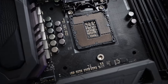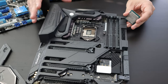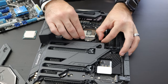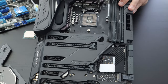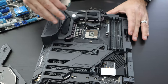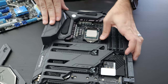This happens to be an Intel-based motherboard — an Asus ROG Maximus 8, which is a great board I've had for several years. It was in my son's computer; we replaced it with a Ryzen 3600 and an AMD motherboard. The socket latches will differ depending on whether it's Intel or AMD. On this Intel socket you lift up the retention latch, carefully drop the CPU into the slot without damaging any pins, then slide and lock the latch into place.